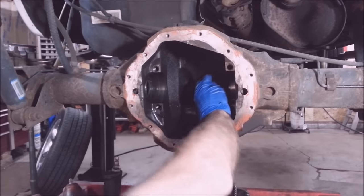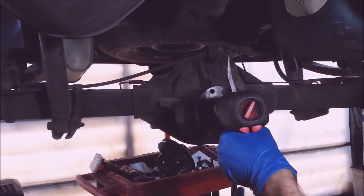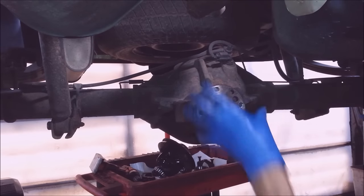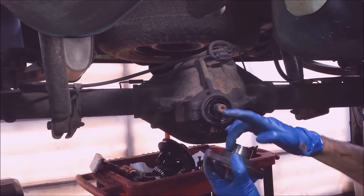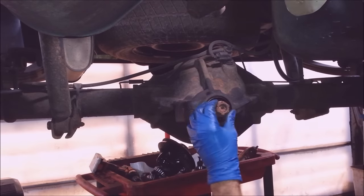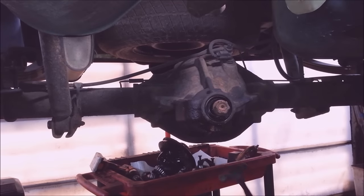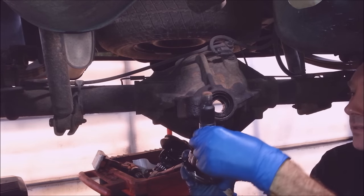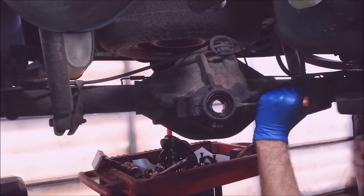Taking the carrier out — it's not exactly light, so you're forewarned. Crunchy. I'm going to start the drive shaft bolts, get that pinion nut off, and just take a hammer and knock this out of here. I'll make sure this surface is nice. Put your nut back on just so you don't wreck the threads on the pinion, then tap this thing through. I'll get a bigger hammer. And there's your pinion — and the crush sleeve. Now I can go ahead and get the pinion seal out of here.